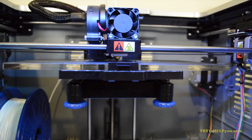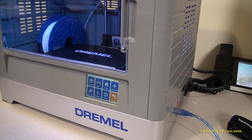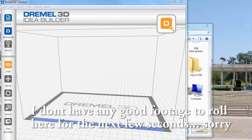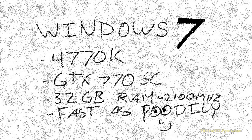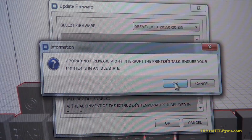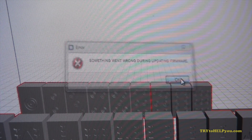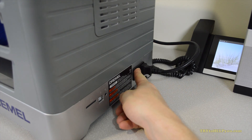After all that, I tried to download the Dremel 3D printer software. The manual says to go to a link, which is no longer the same link, but it went to the right place anyway. You have to register with the website and then sign in, then the download link just appears. I blew about 20 minutes trying to figure that out. Installing the software and drivers was easy — just automatic after installation. I'm running Windows 7. There was an issue when updating the firmware: it errored out, so I shut off the machine, restarted the whole process, and it worked the second time.